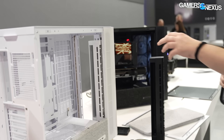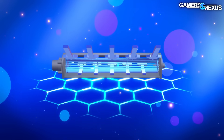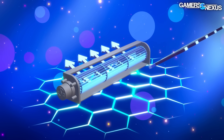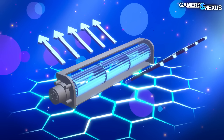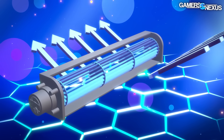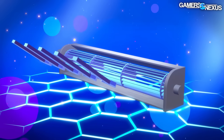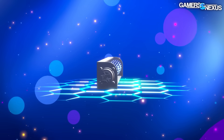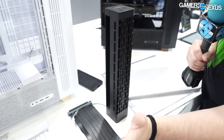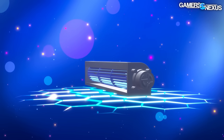As a reminder, a crossflow fan is separated by discs. This one has discs that cut across — those create blocks of fan blades. The fan blades run along the whole length of the fan with a very slight angle to them. The point of a crossflow is that air can enter basically tangentially to the axis of the fan, then it gets spat out towards the camera from here. The air goes in this way and exits effectively perpendicular, with a little bit of an arc to it.